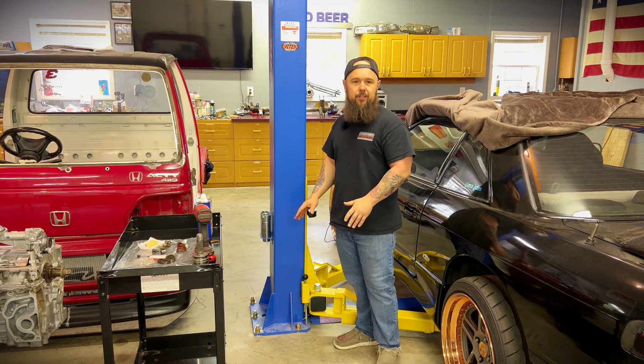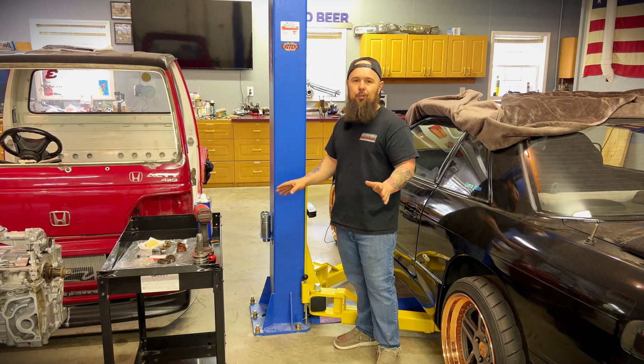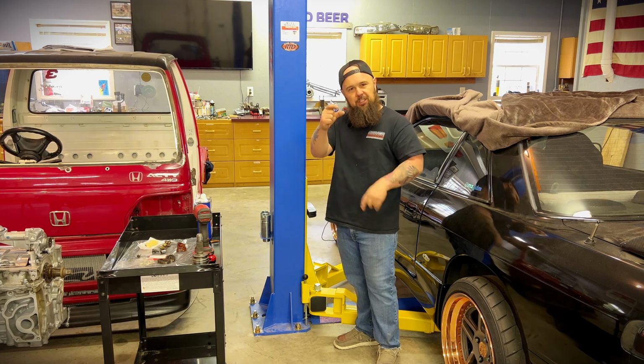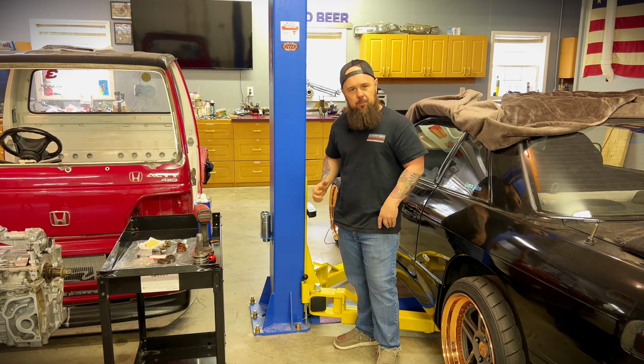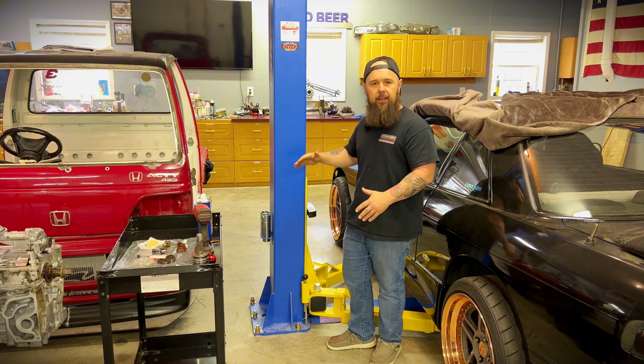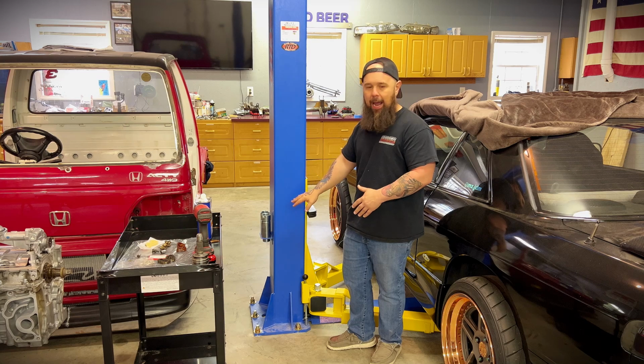The good news is that the actual bolts and the anchors for the lift, they're still good. What happened was the unevenness of the concrete allowed one of the shims, there's these little steel U-shaped shims that they'll put on the low spots of the concrete to get everything perfectly level when they install these. And one of them had somehow managed to kick its way out.